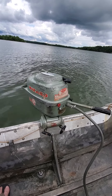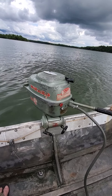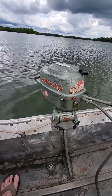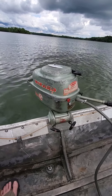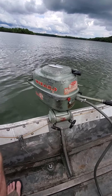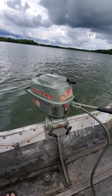The coils were actually in good shape. I had to repair one broken wire off the back of one of them, but no big deal. Got a couple new condensers, put in an impeller, and didn't bother trying to do the seal kit in the bottom unit because it's just more trouble than it's worth. Put her together and she's running pretty good.